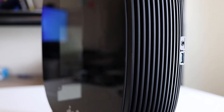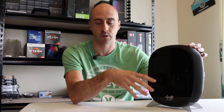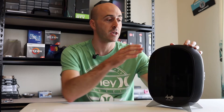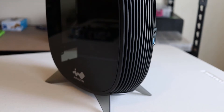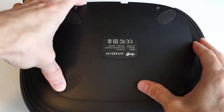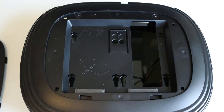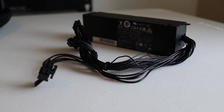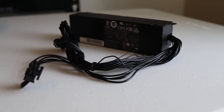The build quality is nice — it's made out of ABS plastic with a tempered glass front panel. The max CPU heatsink height is 60 millimeters. The front ports are one USB 3.0 and one HD audio single plug port. The case also has two 2.5-inch internal drive bays for SSDs or hard disk drives, an 80 millimeter exhaust fan included on top, and a PowerMan 200-watt 80-plus Gold power supply in the bottom.